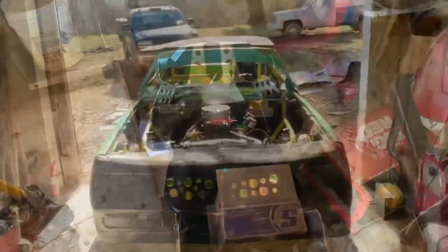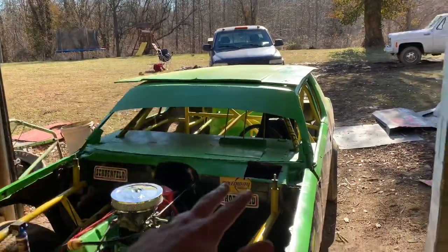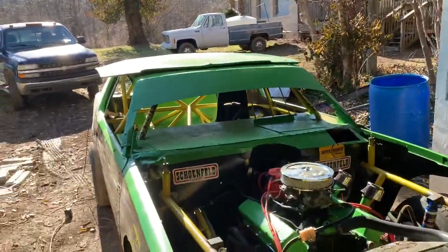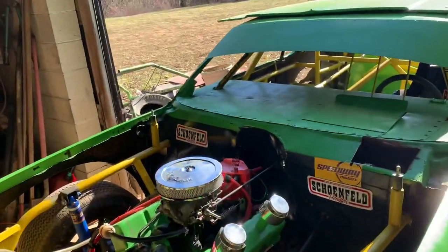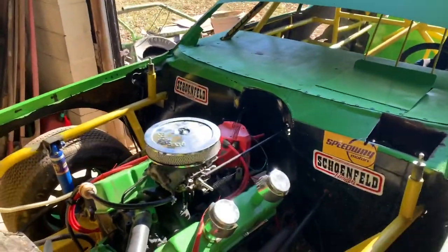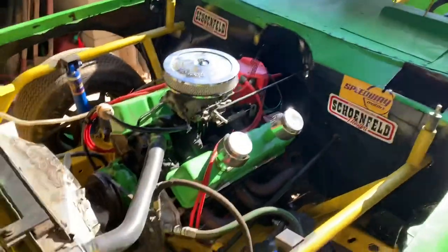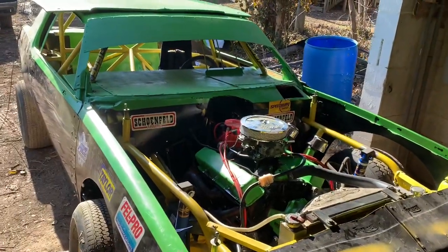It was a pain in the butt but finally got this thing out of here. It starts fine — okay so what happens is you go in, get it started, it starts, but it takes a long time to warm up. You gotta keep feeding it throttle, and before it gets warmed up it dies a couple times. After it dies a couple times it doesn't want to start again. The timing's a little off and the carburetor needs to be tuned. It's backfiring out of the exhaust — it's been doing that since day one — and now it's starting to backfire out of the carb too.